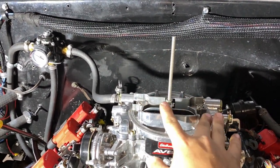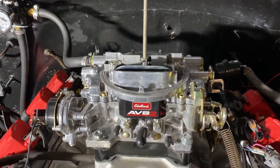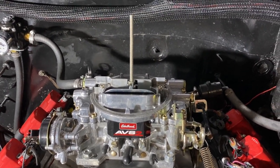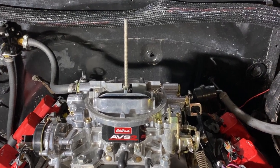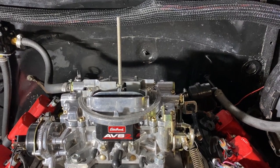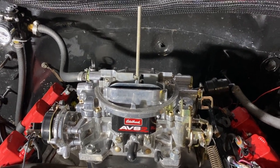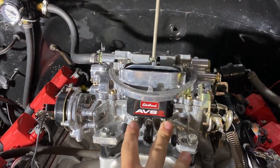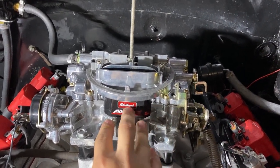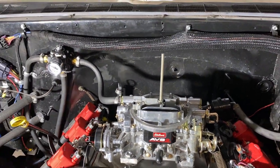A lot of people don't talk about metering rods and metering rod springs on the internet — they're a lot simpler to change than I ever thought. Just remember: if you want a richer mixture, you need a smaller rod. If you want a leaner mixture, you need a bigger rod. As far as springs go, that's going to take a little playing around because that's more application-specific. For the idle mixture screws, you want to find your cleanest, smoothest running with both screws, then adjust the idle to bring you back to your target RPM.